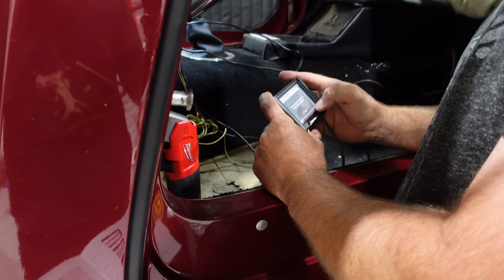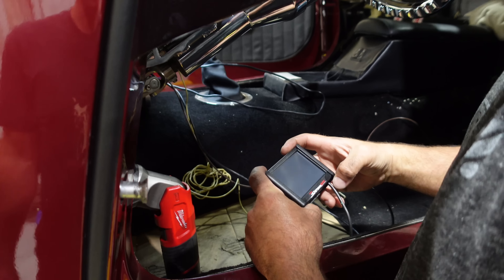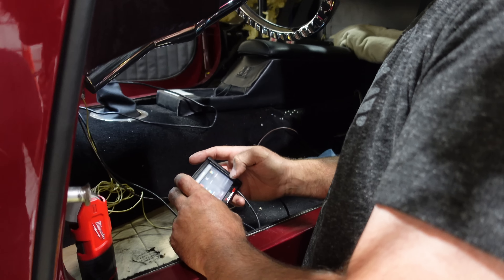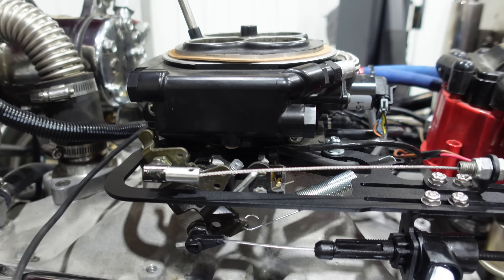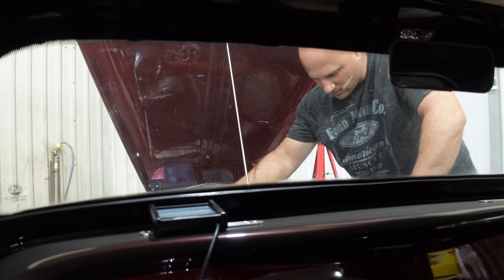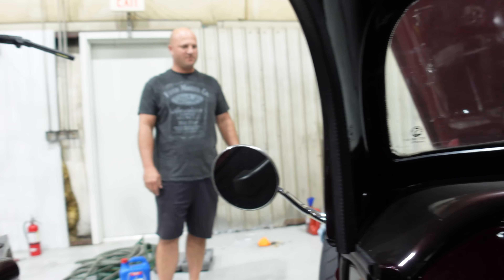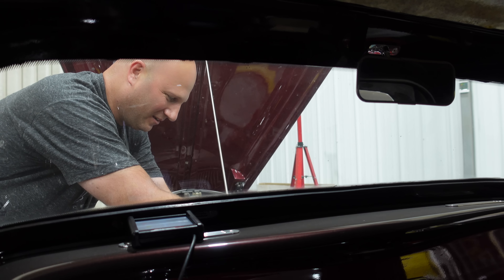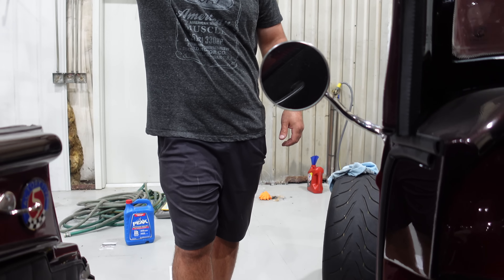There's one thing I'm a little concerned about — what is the pink wire? Pink switched ignition, good deal. It must remain powered during cranking. Start up the fuel pump — she squirted. Clear prop. She tried. Are we losing spark while we're cranking? We shouldn't be. Is the Holley rebooting? Because it's switched ignition. It seems like it sputters when you let off the key.